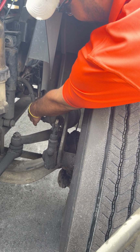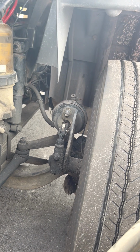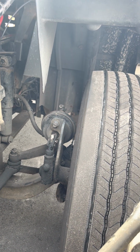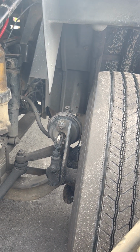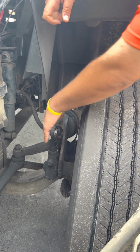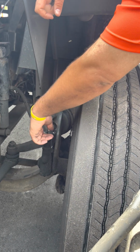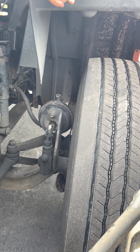You can't call them together. All right, ABS line on the outside. It's not cut or torn and no exposed wire. All right, because it's got electricity running through it. Hose brings me right to the brake chamber. Brake chamber is properly mounted. Band is tight. It's not cracked or broken, and it's not leaking because it's got air coming to it.